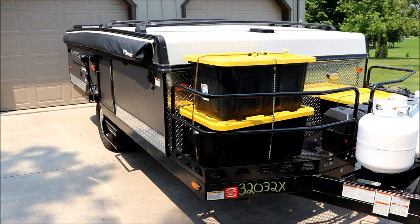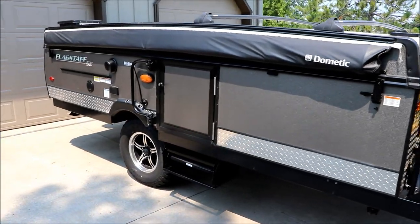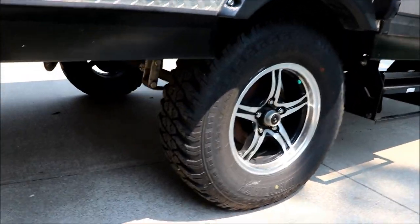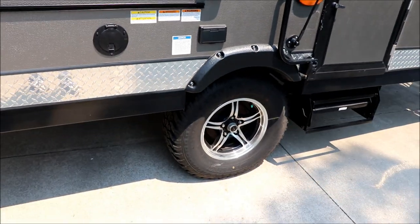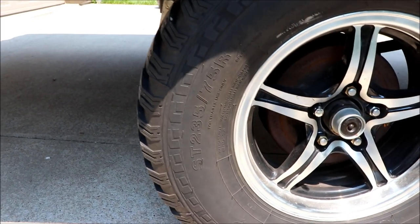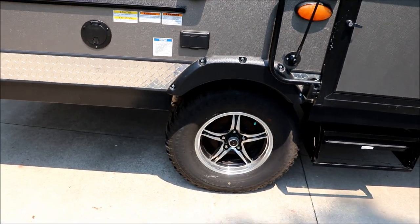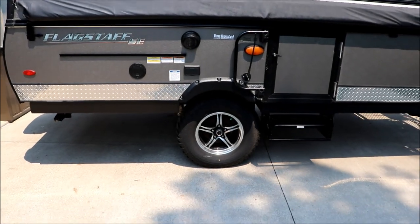We'll do a review — like I said, it's similar to the other one. If you've ever owned a camper, everything's pretty cheap on it; plan to do a lot of little tweaking and fixing. It does come with these oversized off-road tires, which you can't get at your local tire store. I called our largest supplier and they do not carry that size in a trailer tire — the ST 235/75 R15. They can get a tire that will work but it'll be more of a highway ribbed tire, not a lug tire for mud or whatever.